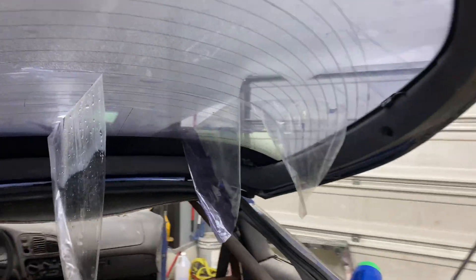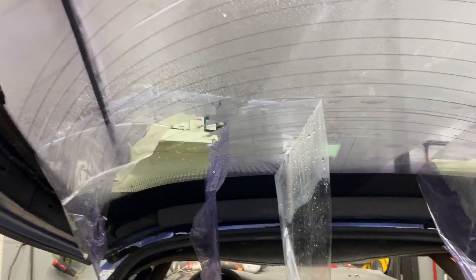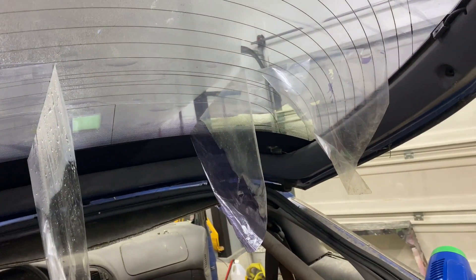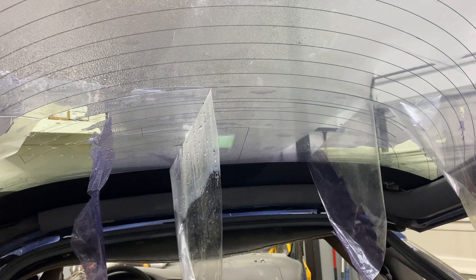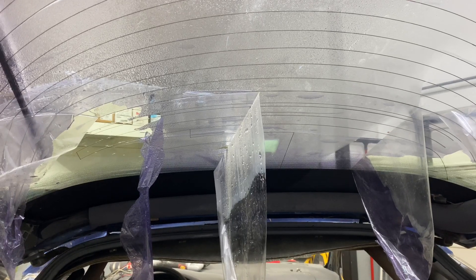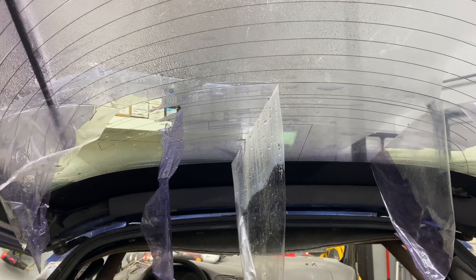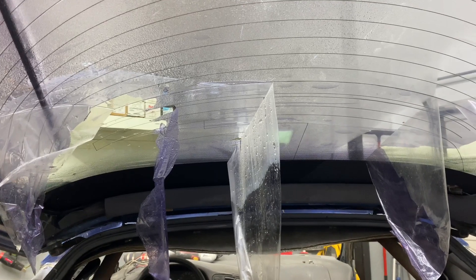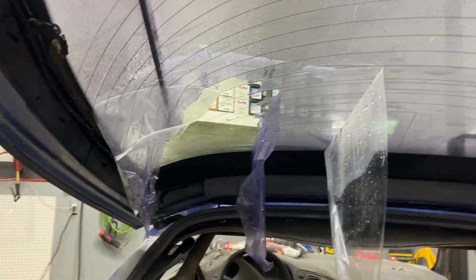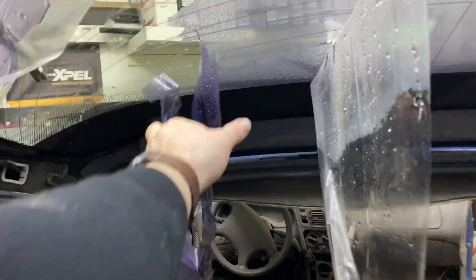Over here, the heat gun would take off the clear layer but it would leave the adhesive. So on this kind of film, it's better to use a steamer. If you have a film that's only a few years old and the dye itself is in the polyester layer, you could still use a heat gun — heat it up completely and it will come off. But with this kind of film, as you're trying to heat it up with a heat gun, you're just baking that adhesive onto the glass more and not allowing it to come off. The steamer can steam all this adhesive off and get it to come off in one layer.